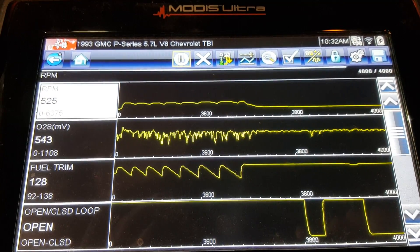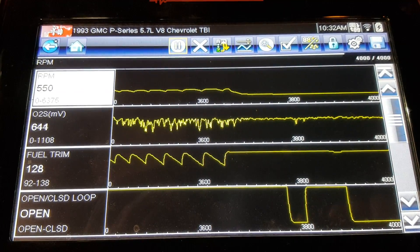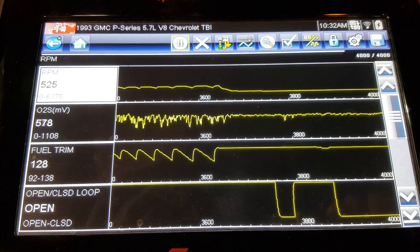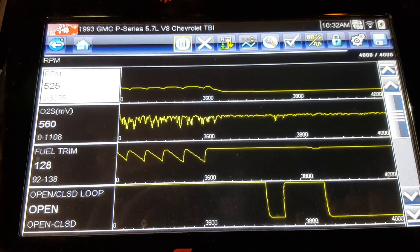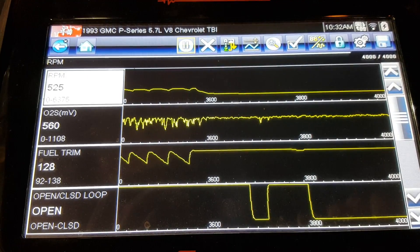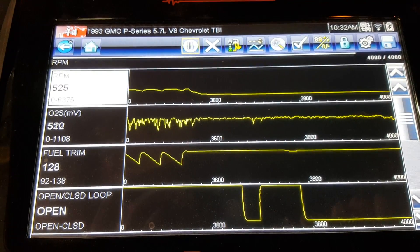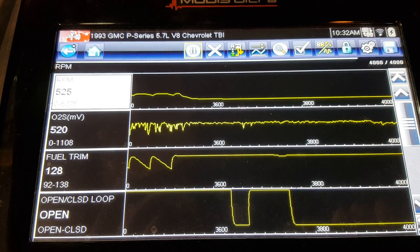So if you got these kind of symptoms and you don't have a scan tool, and it's acting like this — when you're driving down the road and it just kind of cuts out like it's dying, losing gas or something, then kicks back in — I think what you've got is a half-ass working O2 sensor: kind of working, not working.